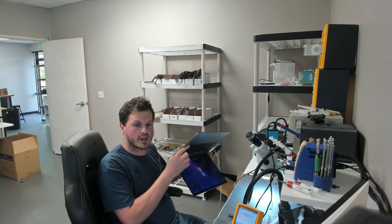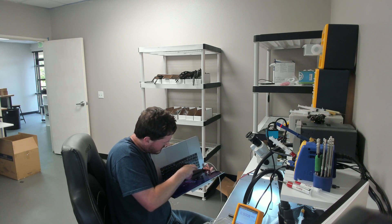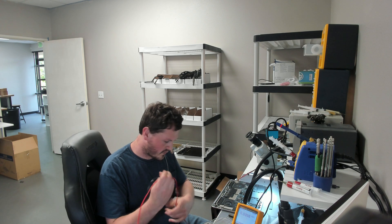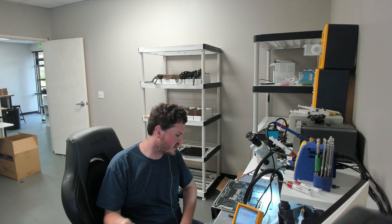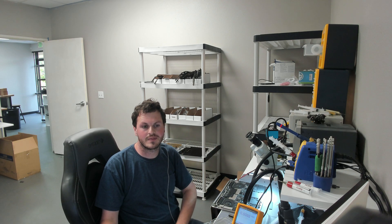We see we have touch bar controls and a working backlight. Brightness all the way down and we're at 48 volts — pretty dim. Measuring again, still 48 volts. Typically, 25 to 48 volts is good. If we have 55 volts, that means we have no load — probably flex gate or a screen issue. Sometimes a PRAM reset will resolve the 55-volt case, so definitely try that first. This is fixed — we had a short on backlight output, simple capacitor replacement, good to go.